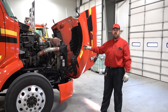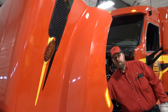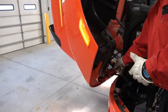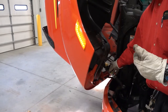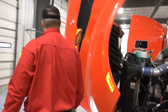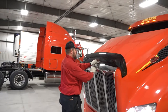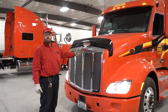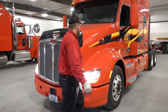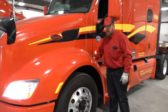With the Peterbilts, there is a latch on this side that you must release for the hood to be able to come down. It's a safety system so that while you're underneath here inspecting things, if the wind were to blow, it's not going to bring the hood down on top of your head. Simply press that down, come around here, and close your hood in a controlled manner. Don't just give it a shove and let it slam — it's hard on things. Then latch this side.